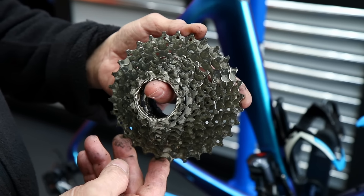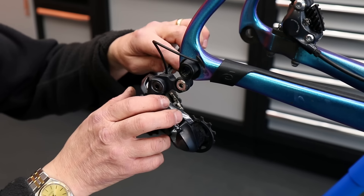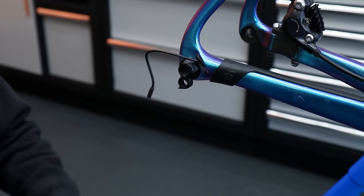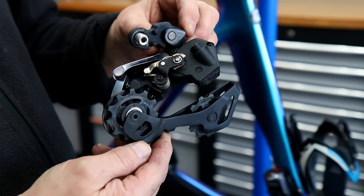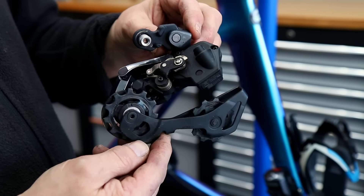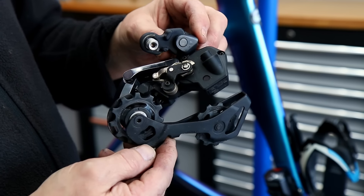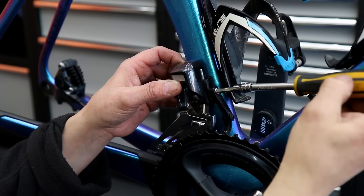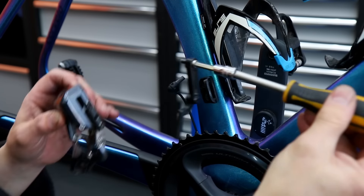You can see a little bit of grease and oil build up on there so we'll clean that through, but we're also going to take off the derailleurs and clean everything up nicely as we always do. You can see the rear derailleur has very little dirt on it but it is dry - it needs a little bit of lubrication. We'll clean up those jockey wheels and make that really nice, because with a bike of this nature we don't want to cut corners.